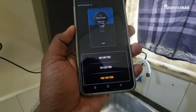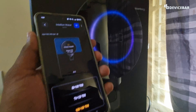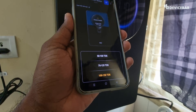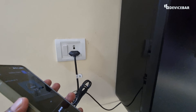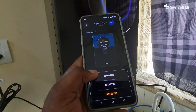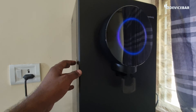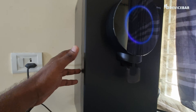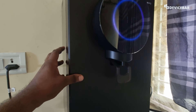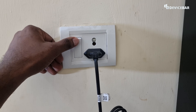Right now we have set the TDS level from 100 to 150 — you can see the display value says 110, which is within the 100 to 150 TDS range. Suppose if I want this to be 50 to 100 TDS, then I have to switch off the water purifier and drain all the water first before enabling this option. We have to empty the tank first before enabling the Taste Tune mode, otherwise if the tank is full it will take a lot of time to see the changes. We can fill our water bottles and cans to empty the tank.